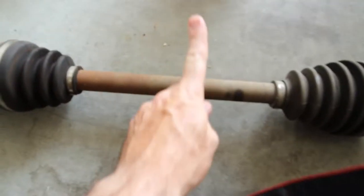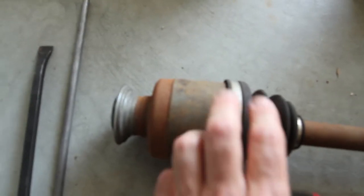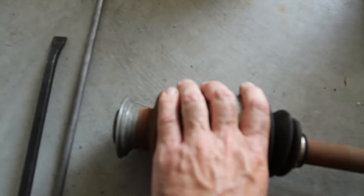I want you to follow me on this journey: we go through the axles, we go through replacing the intermediate shaft bearing, and finally find the problem with the brake rotor itself. If you've got a Honda Odyssey that has a vibration problem, you will find this interesting. Yesterday I took out the passenger side half shaft — this is forward, it sits in the vehicle this way, that's the wheel, and here it meets the intermediate axle. There was a lot of play — not between these two elements which meet with the spider rollers, but between the intermediate axle going in here and this boot element.